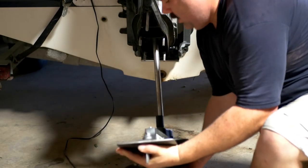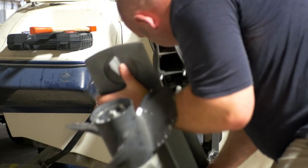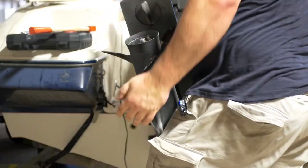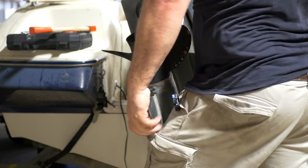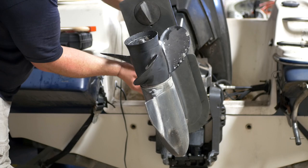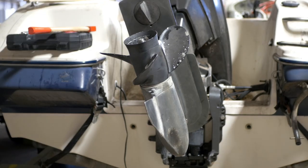I've changed my angle of attack and I took the spark plugs out too, so it's easier to spin that flywheel and get the proper orientation. Success! My hands are too big for this job. If you want to be a mechanic and you have big hands, find something else to do — and I'm not a mechanic for that very reason.